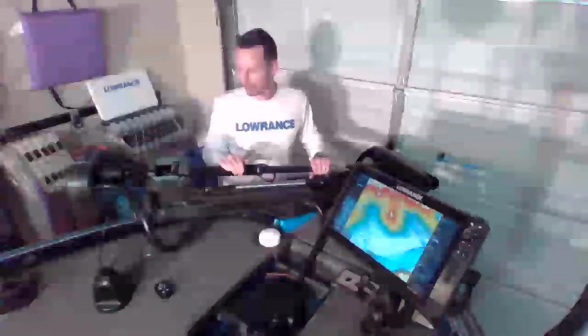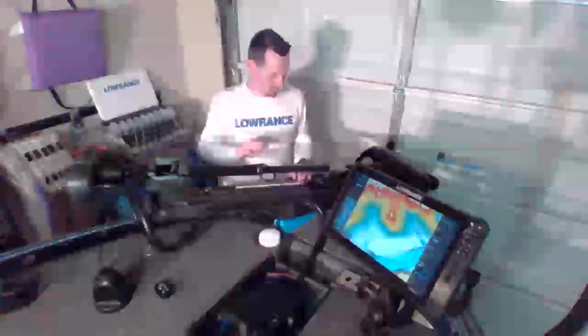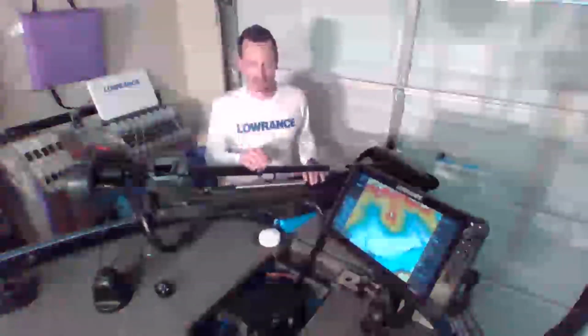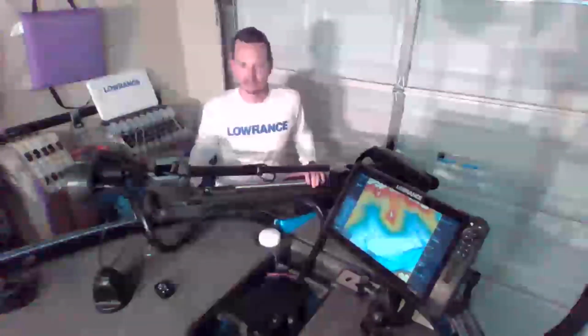Hopefully we can get a good picture or diagram up for you. Basically, there's a safety trigger mechanism so that the mount will not open until you put the 360 breakaway on. That is so that you don't accidentally have the mount with the shock in it open too quickly. It would actually be very fast opening. So the main thing is, when you put the 360 on there, you engage that safety. And you can see the little tab that hangs at the bottom when you're making that install.